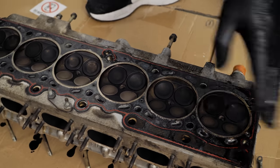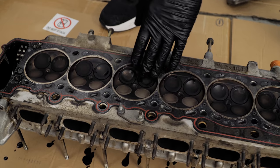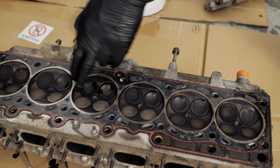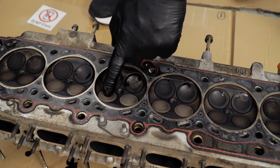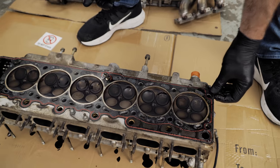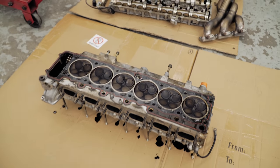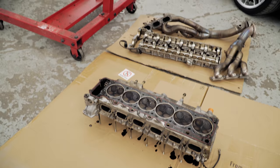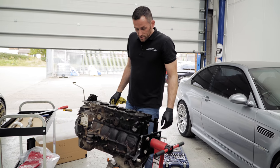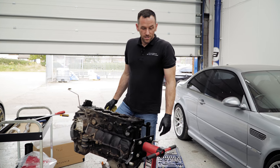Yeah. So everything looks good. All the valves are nice and clean. There's no hot spots anywhere. No marks on them. Nothing. They've been running slightly hotter, those two, you can see. A little bit whiter in colour, but again, that looks perfectly normal. I suppose without having control of every bank's mixture, you might get two cylinders running a little bit leaner. It's just the way they are.